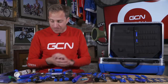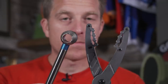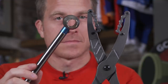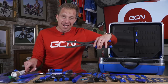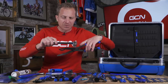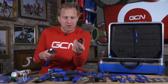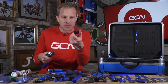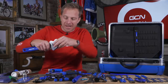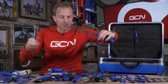Something I'm really a big fan of are these cassette pliers. You can get a standard chain whip, which Park do offer, but these enable you to hold the cassette in place with one hand when it comes to removing it from the freehub body. Of course you're going to need a tool to release that too — and this one, I've been wanting one of these for so long because it's got the handle built into it. You could use an adjustable spanner with a freewheel or cassette removal tool, but this one is actually for a bottom bracket. You just put it on, grab it, do it, release it, go. Big fan of this one — really sturdy too.